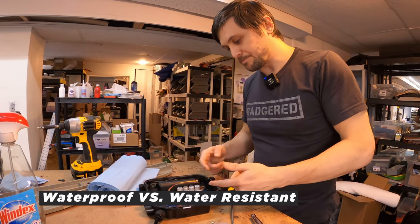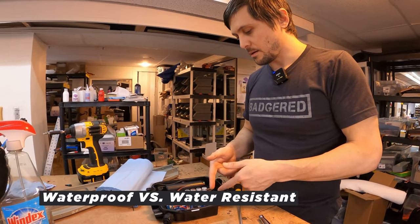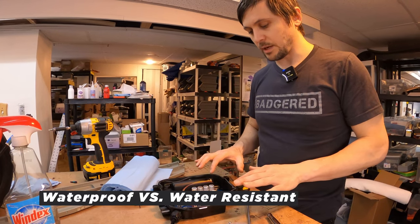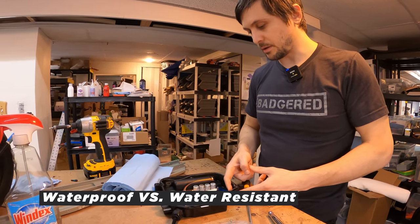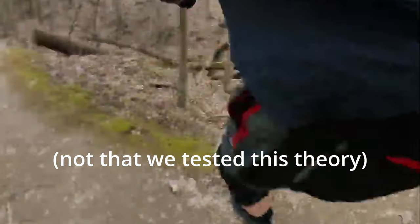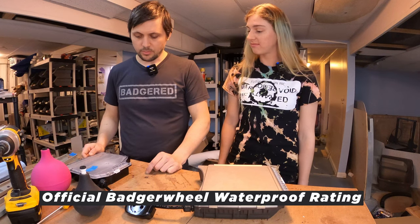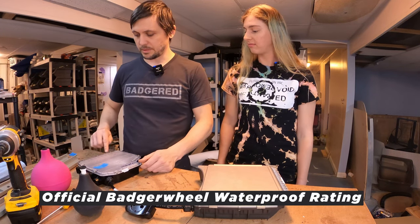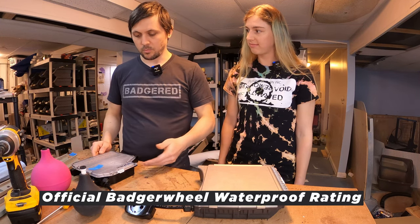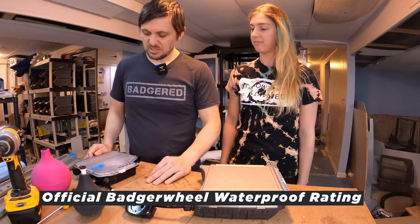They had some unique challenges here, namely the heat dissipation. The adhesive thermal compound is a great way to get heat out of these MOSFETs and into the metal case. The downside is that once you stick it on, you can't really slide the board in order to get it butted up tight. On a scale of one to five — one being if you sneeze near it, it might brick, and five being you could throw it in the river and fish it out and ride it home — the GT is probably a three. The majority of these are going to be properly sealed around the top where it matters. This is really a bad place to have a leak because this is right where water is going to come splashing in if you're riding in the rain or wet conditions, and the most sensitive components are right on the other side of that. But this one is pretty good.